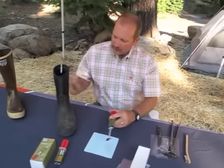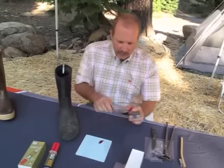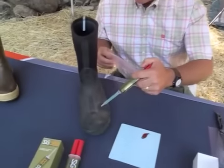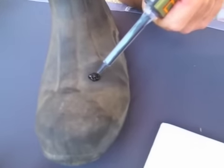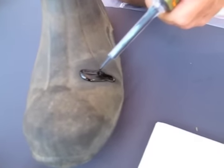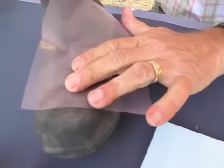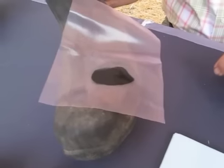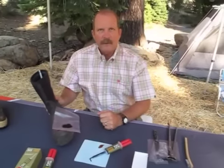So we've got our boot, we've cleaned off the area. All we're going to do now is shoot the material on and use the contouring plastic. I'm just going to put a little bead of the SG20 on there, then put my plastic on just to kind of smooth it out and leave it. We'll leave that there for about five or ten minutes, pull the plastic off and we're done.